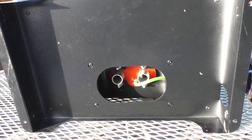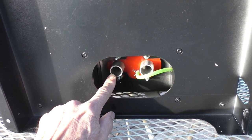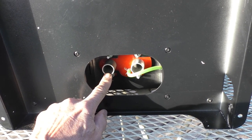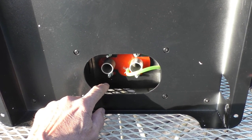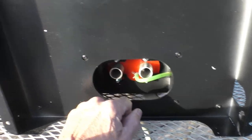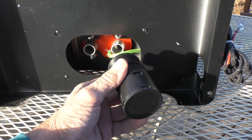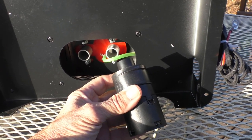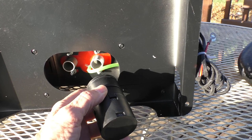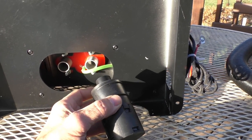On the underside of the unit, the actual heater itself has an exhaust port where combustion gases from inside the heater exit. You have to put an exhaust pipe on this thing and route it out just like you would an exhaust pipe from any kind of engine — that has to be figured out as to where it's going to be placed. This is the fuel line going into it, and this is the intake going into the engine. They provide a hose and silencer that you put on there to bring air in from a remote location. Basically you're keeping everything that goes on inside the engine outside of your confined area, and only warm air is pushed around the outside of the engine through its case and into the space you're going to occupy — there won't be any exhaust gases getting in, provided everything is located properly.